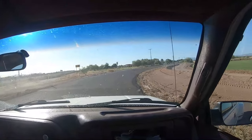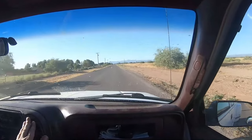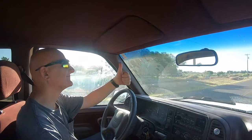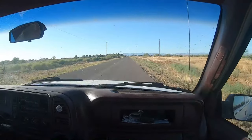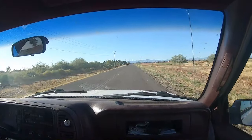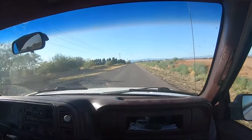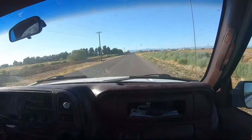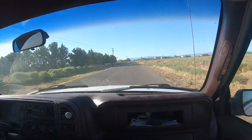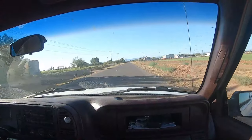We are in the truck now doing a test drive. It feels nice in here. We've just put in about 10 miles. AC's blowing cold. Got a happy customer — thumbs up. One thing to watch out for: we forgot to put the switch back on the receiver dryer, and we were cracking our brains trying to figure out why the heck the compressor wouldn't turn on. A stupid mistake like that can make things really frustrating. Always remember to make sure you put everything back just the way you found it — quick tip, save yourself some trouble and frustration.